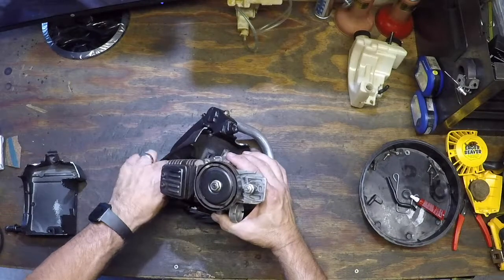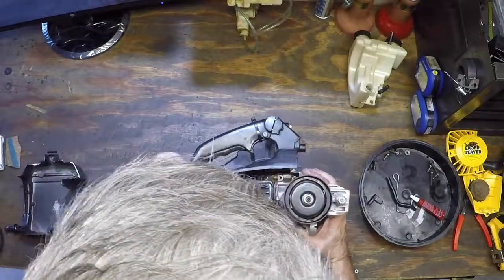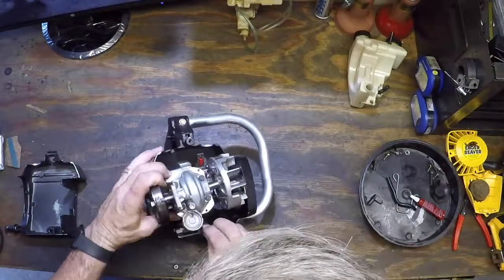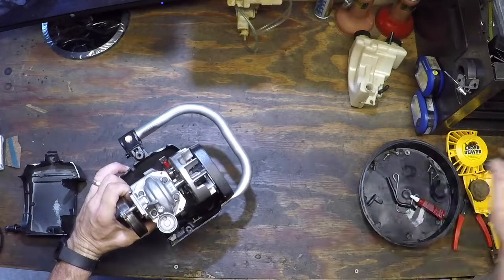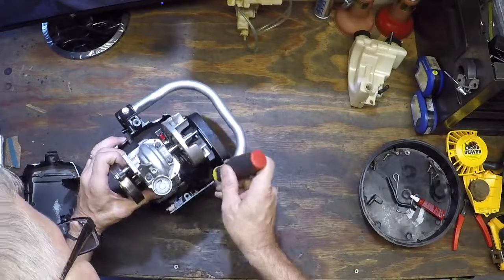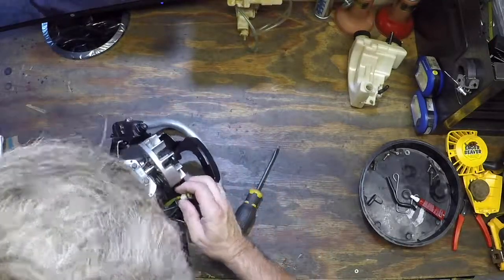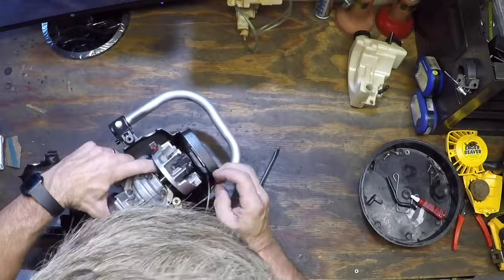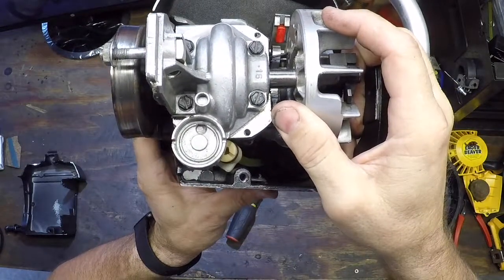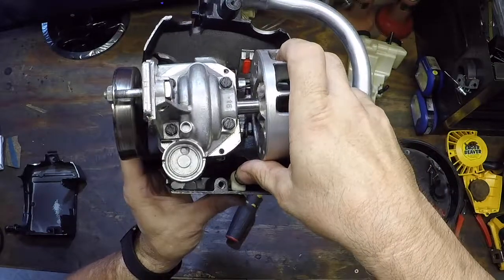Let's get the boot in. Now the boot's sticking out the other side. Next is getting the fuel on. Now the fuel line has pushed itself down. Now the screwdriver. Now the wire. Bring it around. Making sure that the fuel line actually gets into that groove is the hard part, because you've got to push down on the hose, hold it in place, push it down, and then slide the engine at the same time.